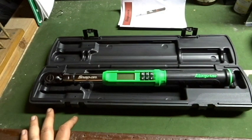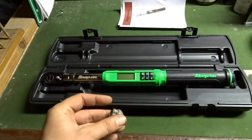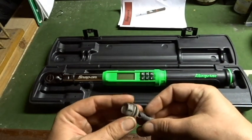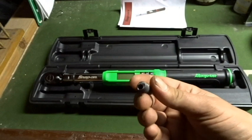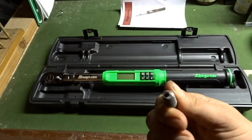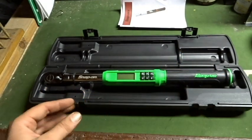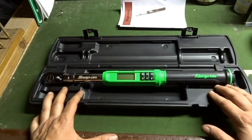There are many reasons why I wanted to get it today. I had a motor mount bolt and I had to use a half-inch gun to zap it off. A couple extra hits later it sheared in half. We ended up using a left-handed drill bit kit to drill a hole and use an extractor. The extractor gave out, so we had to use the Matco extractor set to get it the rest of the way. We finally got it out and got a replacement bolt.